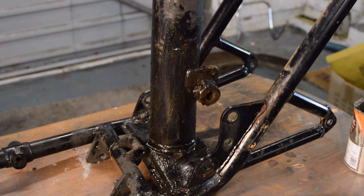I'm going to continue, working my way around the frame — well, actually I'll strip it off around where I said there could be damage and bring you back once it's all stripped around here. After a quick scrape and a wire brush, the paint stripper has worked exactly as I expected. We're down to very nearly bare metal on the first attempt — in fact, some minor abrasive work could probably get that sorted. I'll give it another coat.